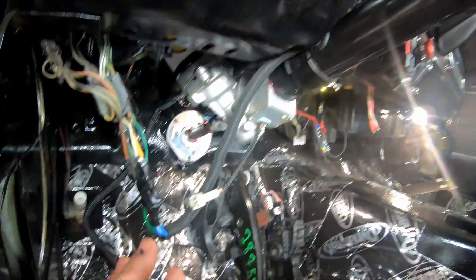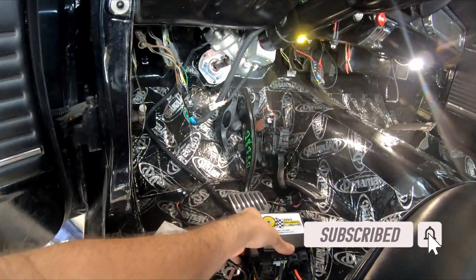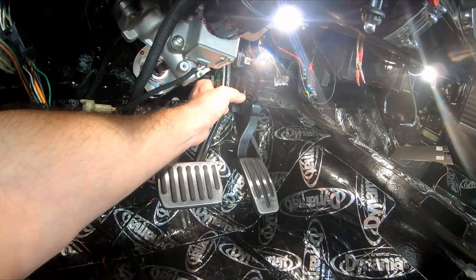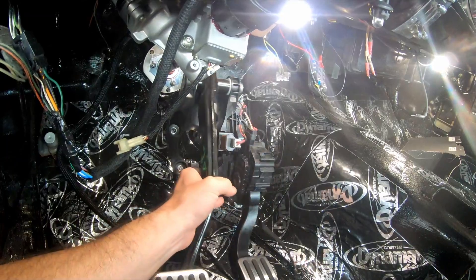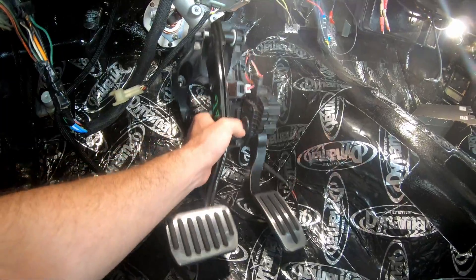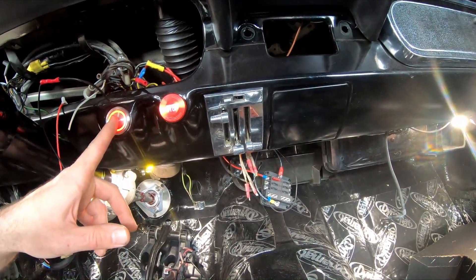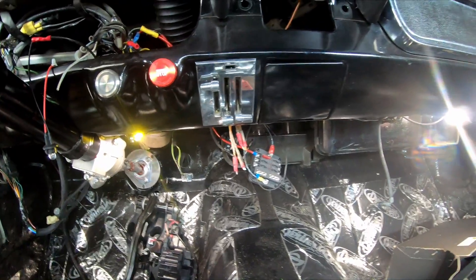So you can see the stuff I have together — that's all finally together. This turns, but it's not powered or anything yet. I have to mount this up under the dash, but I need to get some captive bolts for that. A future project is going to be getting these pedals in the right spot — these are from a Tesla Model 3. A lot of people use just the throttle pedal in their EV conversion builds, but I'm hoping I can use this whole assembly. These are the chrome pedals from a performance model and I think they're kind of cool. Over here you can see my buttons — that's going to be my power button to turn the thing on and off, and this is the emergency kill so I can turn everything off quickly if there were any issues.